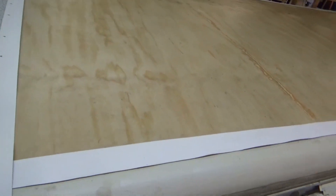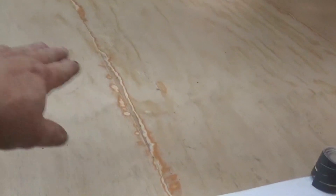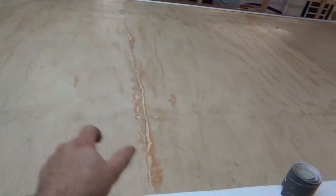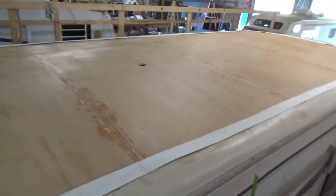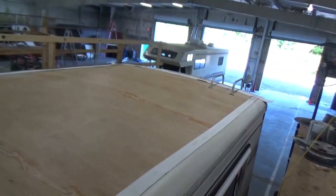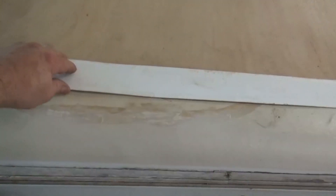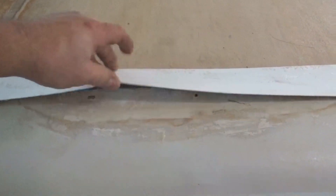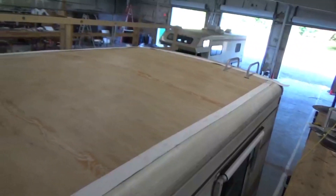This is our Winnebago update. Now we've re-decked the roof. If there are any inconsistencies, we kind of sanded it down a little bit for a nice smooth transition. This is real tight — we won't need to put strips across this. All we did is sand down where a couple of high spots may be from the old roof; sometimes it will cause a little buckle. Other than that, we're ready to put the roofing material on. This banding buffer is for the edge — there are some staples and stuff under there, so it's a prudent measure to make sure we don't have anything compromised on the main roof.